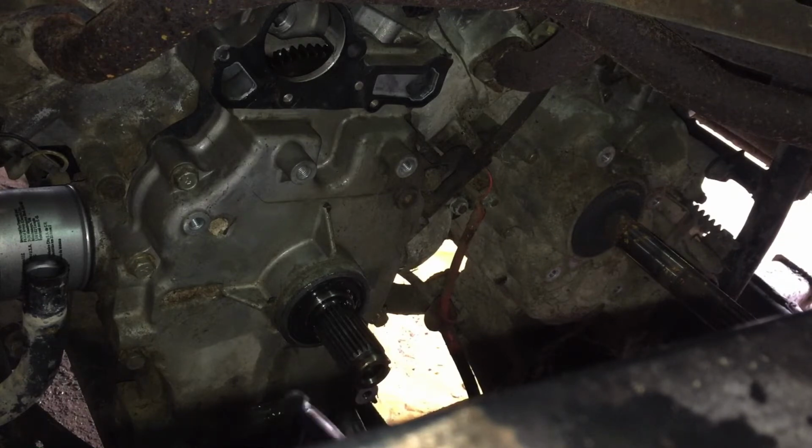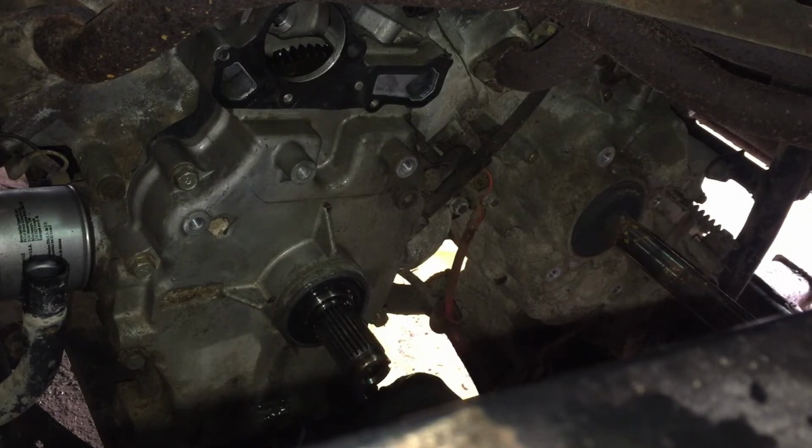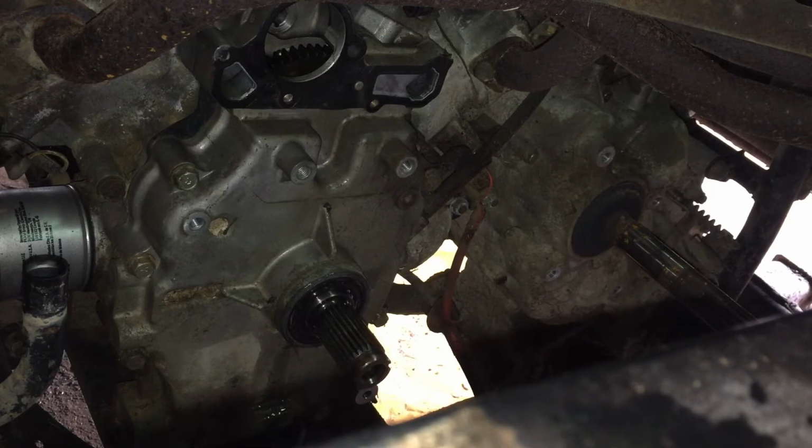Like I said, I think that's a drain plug right there, so we don't need to worry about that bolt. So there's one, and these ones that are a little more rusty are the bottom ones. That will help us remember. You just need to keep track of these in case they're different. After I pull each one out, I'm going to look at the size, the length of it, and of course the diameter of it, and see if they are the same size bolts. If there's any that are different, I need to make a note of where they go.